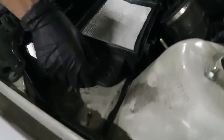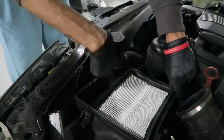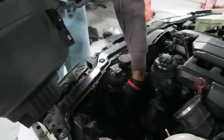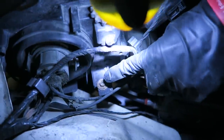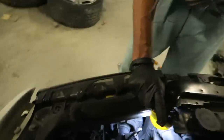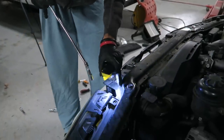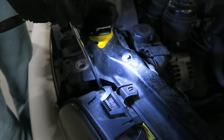Once you have the two air box bolts out, most E46s have a little air duct that goes between the headlight and the radiator — just be careful taking it off so it doesn't get bent. Now you can see how much more space we have. There's a bolt right here and another one in this corner — those are the two bolts holding the headlight to the headlight support. The headlight support is attached to the radiator support. It's going to be a lot easier to get to the bolt through the gap between the headlight and the radiator support. Try to use magnetic sockets so you don't drop the bolt.